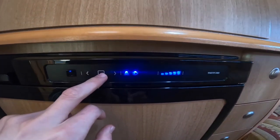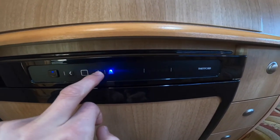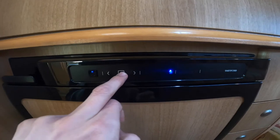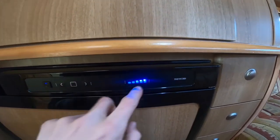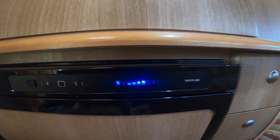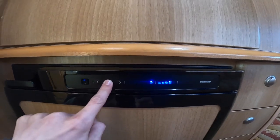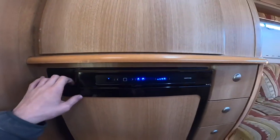If you want to manually change it, press and hold the square button to move away from automatic to manual. You can select hookup, battery or gas. Then press here for temperature — 5 being the coldest, so when pre-chilling you may want it on 5; when you put your shopping in you may want to turn it down to 1. But you shouldn't need to — just leave it on automatic and it'll do its own thing.